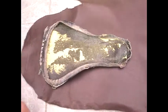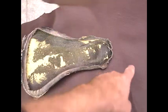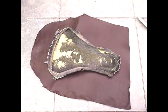So that'll be next. We'll cut out a scrap of leather. Essentially, when we look at this, the Romanian pig is much thinner at this end than it is at the other end, so I'm going to use the thin end. I'm going to put the old seat on there and just make sure I've got enough. I'm going to probably mark it off about here and then cut it with the scissors. Just to show you, this is the piece of leather that's now been trimmed away, and that's now ready for sticking.